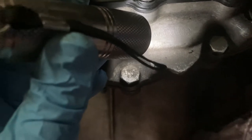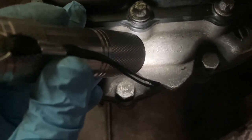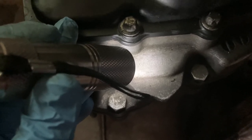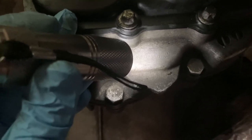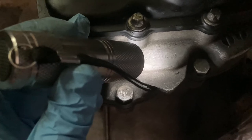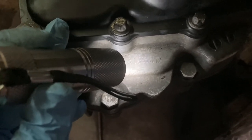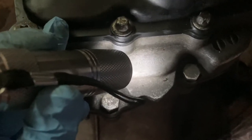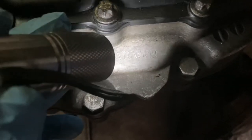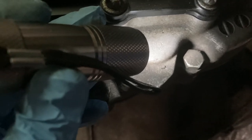What is interesting is '86W419'. '86' indicates a five-speed gearbox of the F17 model with the longer ratios. The F17 box is common on many Opel and Vauxhall applications and has been around since around 2000, going through some changes over its life — for example, in later years they added a synchronizer to the reverse gear, making it easier to engage reverse without grinding. '86' is the F17 box with wider ratios specifically for the Corsa D. The 'W' also indicates it's a wide-ratio gearbox, and the last digits '419' indicate a final drive of 4.19 to 1.